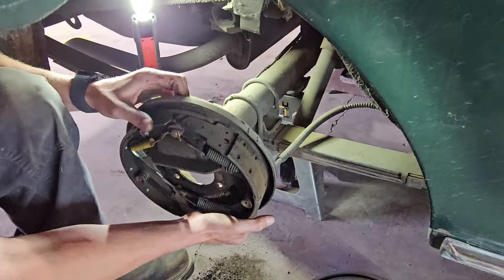I will now be installing our rear axle seals. I'm just going to put some sealant around this lip in here. Now we're going to get this thrown in there — start it and make sure it's centered. You don't want to start one side first; make sure it's all mostly centered so it goes in a little bit smoother. Take a seal driver and just start tapping it in.